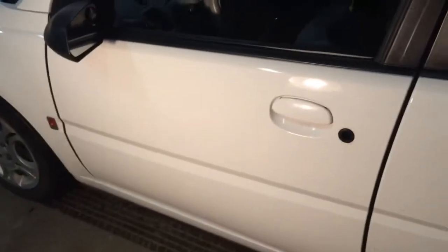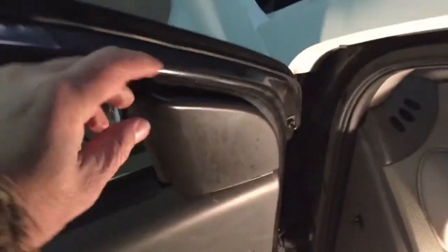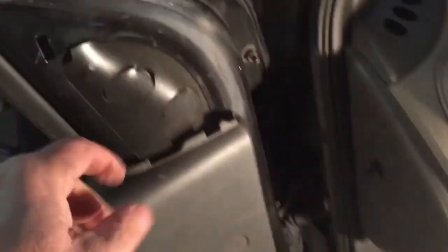On this door, I'm going to see if I can get that back on there. First thing I'm gonna do is pop this interior panel off, get in here, get these nuts out, get this outside mirror off, and get this outside door handle off. There's a little pin you pull out, slide the handle to the left and it'll come out.